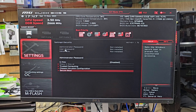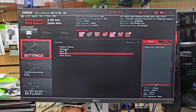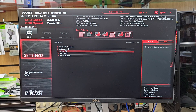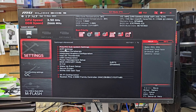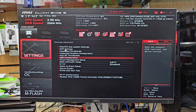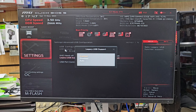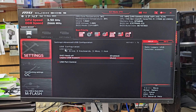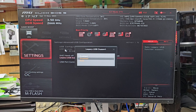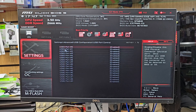Now press the ESC button twice to go back to the main settings menu. From here, click on Advanced, which is the second option, and hit Enter. From here we need to go to USB Configuration. You can see the Legacy Support option — we have to make it Auto or Disabled. Remember, if you keep Secure Boot on, Legacy has to be Disabled or Auto, but never Enabled — otherwise it's not going to work.